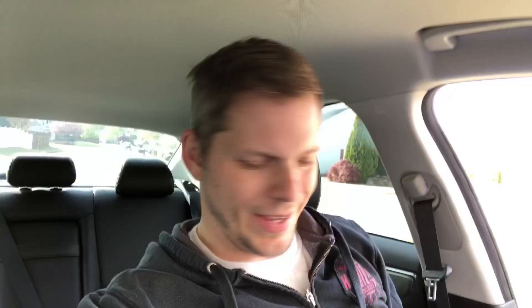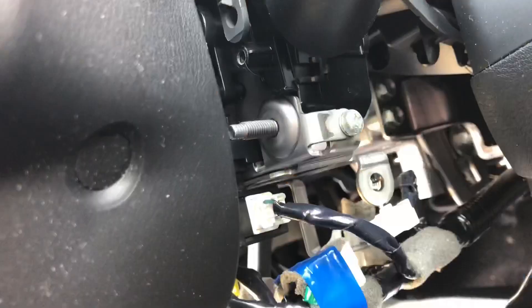I thought I had gotten lucky and thought the salvage yard had retained all the hardware, but really I just got the two bolts. I'll put the hardware part numbers from Nissan in the description below. The website says it's not available, but you may be able to find it or at least get the proper thread pattern. I know this is a 10 millimeter head on these bolts, but she will need a nut — the nuts did not come from the salvage yard. The nuts go right on that little stud there. I might have something in the old hardware bin and we'll see if we can get this wrapped up.